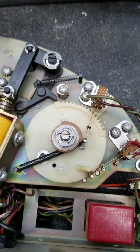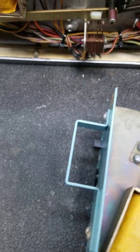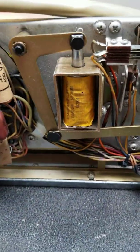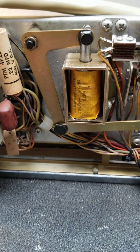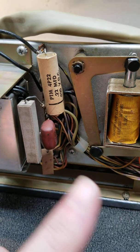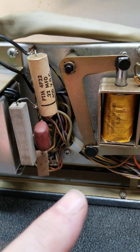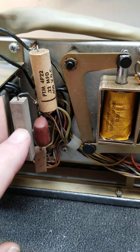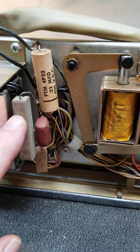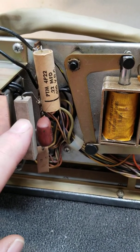The reason you shouldn't do that is because it will hold in this solenoid until you trip the buttons for selections and it pulses. These things were made to make money — they weren't made to be on free play. So with this solenoid engaged, this resistor will get really, really hot.